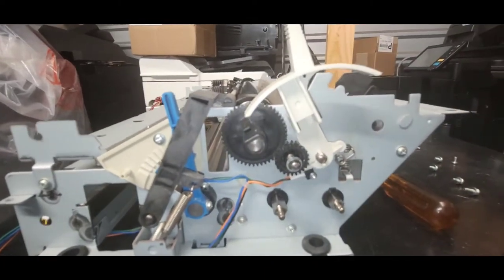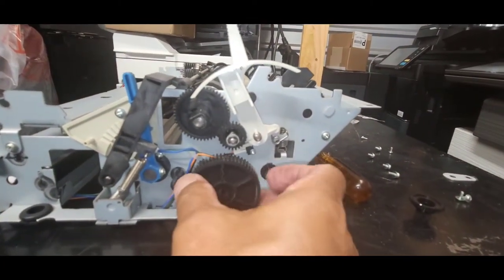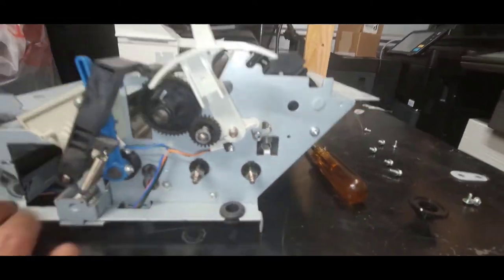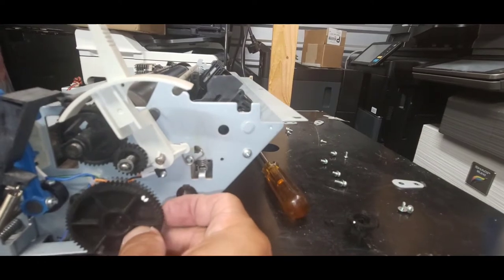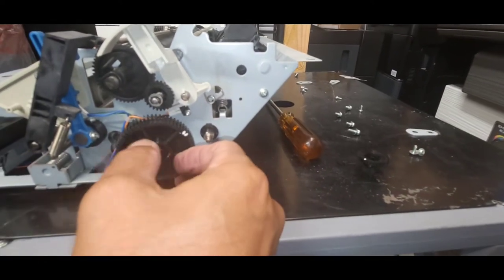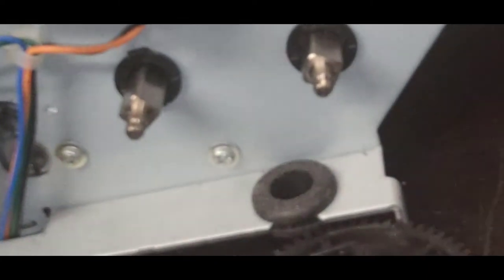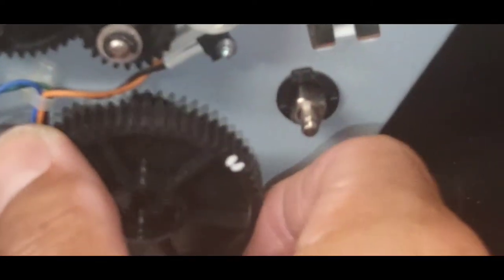All right, now for the gears on this side, and we want to make sure that the white, I'm looking at that, the left gear assembly, I can see the white mark. I want to make sure that this white mark is on the same side as the tractor feed. So